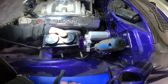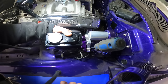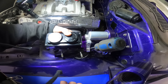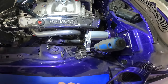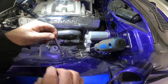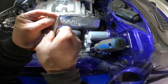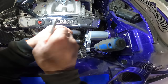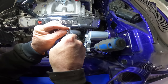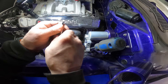Could you tell me when I'm in? There we go. Okay, so what do I got there? Probably 3/16, maybe a quarter. I still have to take that off, so I pull it out. Pull this back out, and what I'll do is go put it in the grinder and grind down to here. What I really should do is put the calipers between that, get some kind of idea, make a mark, and then grind down to that and then retaper it. So let's go to the grinder.